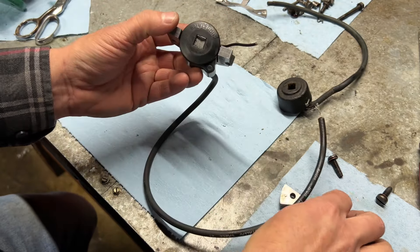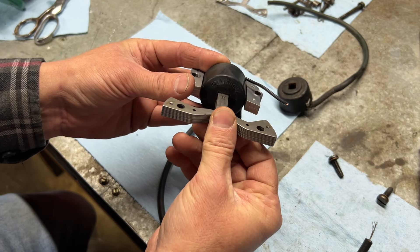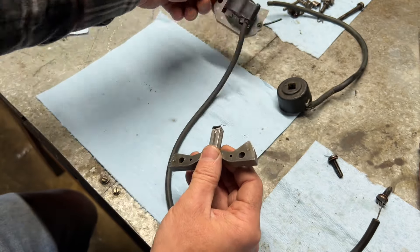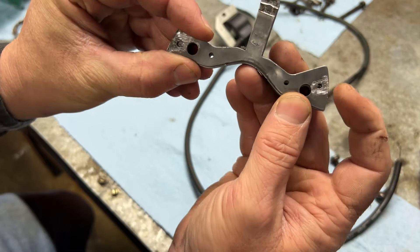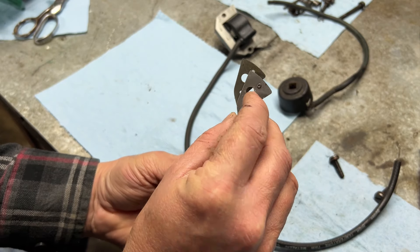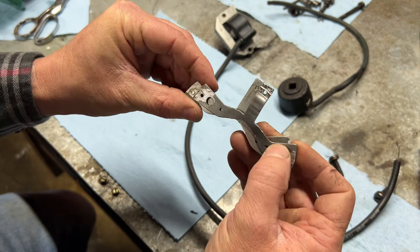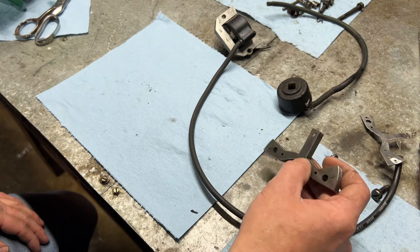I got this new coil and my armature for my Clinton coil, and at first it was not fitting right - the square was just off by probably twenty thousandths of an inch. What I ended up doing was - one of the laminates on here has a metal dowel that goes through the middle. You can see on the back that dowel on both sides, going through all your laminates. I got my grinder and ground the end of that dowel so I could pull one laminate off. Now before you do this, you might want to try something else first.